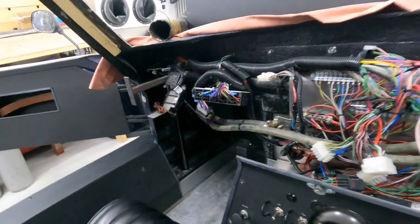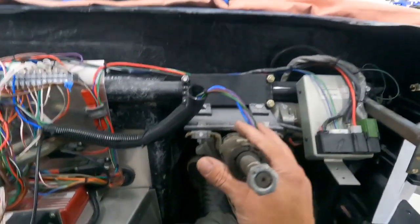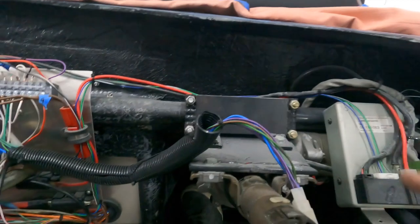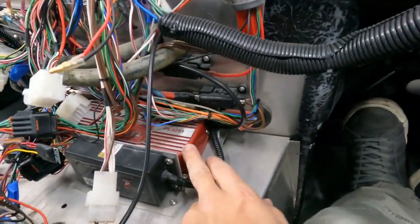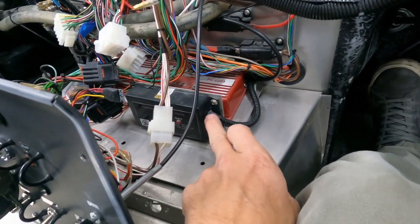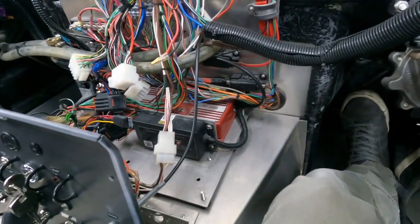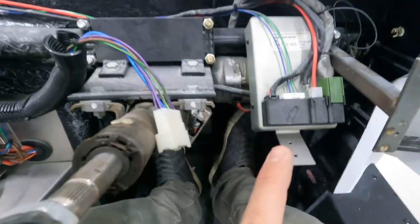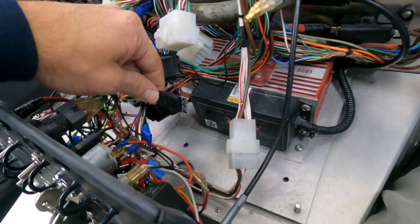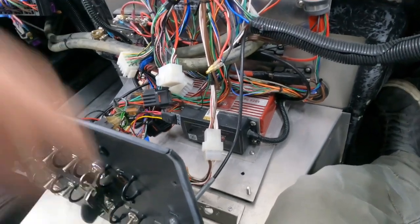Welcome to the naked inside of the car. Here we have the Corsa B steering column electronic power steering - the motor's here and this is the control box for it. We have the electronic ignition system, the MSD unit there. This is the easy steer controller which takes a feed from the drive shafts at the back of the car and tells the power steering how much assistance to give depending on how fast we're going. There's also a little unit here which tells the fog lights to go off when the headlights come on - that's an IVA requirement.